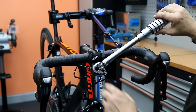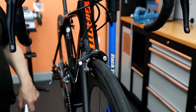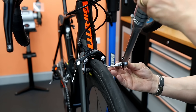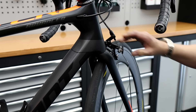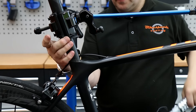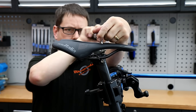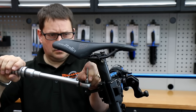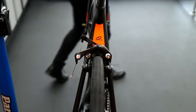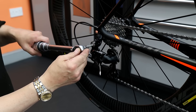We're now torquing up the rest of the bike. The headset bearings obviously need checking since we've changed them — they're absolutely spot on. We check the pinch bolts for the brakes, the brake pads themselves, torquing the mount so it doesn't come loose. The seat post bolt was very loose — that was very dangerous and could have been an accident waiting to happen. The saddle clamp was also loose, which could have ended up a similar accident. Both have now been torqued up safe. The rear brake pads are also torqued so they don't move on the rims.